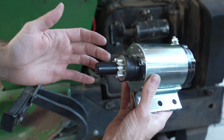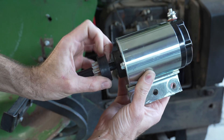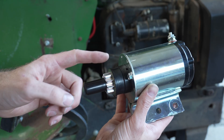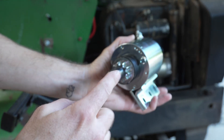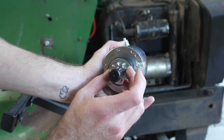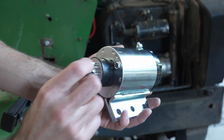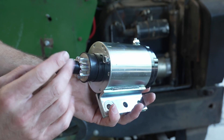While I have this good starter out, I can show you what is going wrong with that one and how this works. This is a Bendix gear, and it is riding on a splined helical cut shaft inside there. When you turn the key to start the engine, the shaft inside this pinion gear starts to spin. Inertia holds this gear in place for just a little bit, so inside the shaft spins counterclockwise. This gear, because of inertia, wants to stay in place, so it's almost like it's spinning this way on that shaft inside, which is what pushes that gear out and allows it to contact the flywheel. And then once the motor starts, the pinion gear starts to spin faster than the shaft of the starter motor, which allows it to spin back into place on that helical gear.